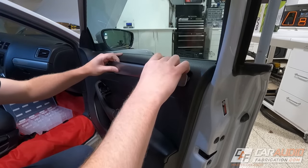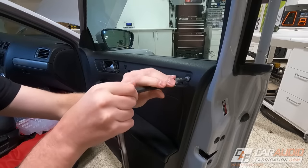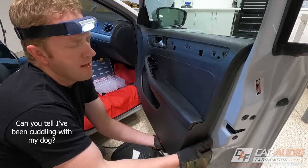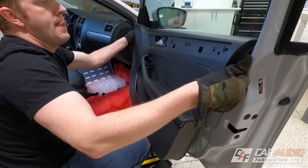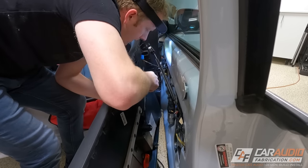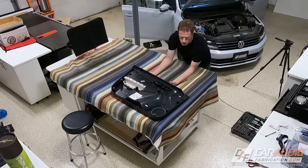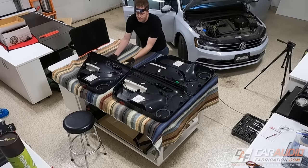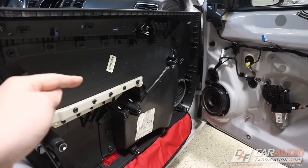When you're removing the door panels you're usually going to have some sort of trim that is press fit that needs to be removed with a panel tool, and that will give you access to bolts that you can undo. Once those mechanical fasteners are all removed there are additional press fit fasteners around the outside perimeter so we can go ahead and unsnap those to pull the door panel off. We can then carefully reach behind the panel and unplug any of the wiring harnesses. Rather than sound treating one door panel at a time I like to make sure that I have all four removed so I can be consistent in how I apply the materials.